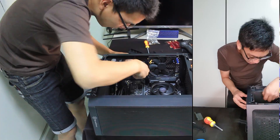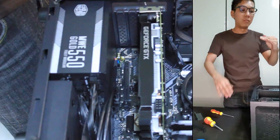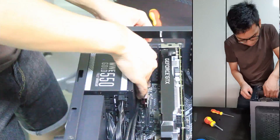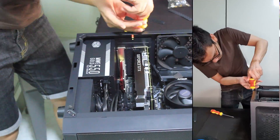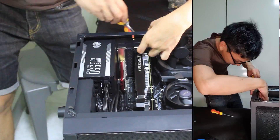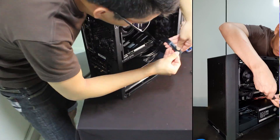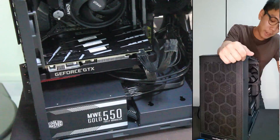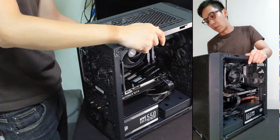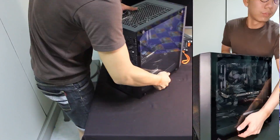After that, remove the front side panels because we are going to be installing the graphics card as shown. Make sure the graphics card latch on the motherboard is down, fit it in firmly and securely, then fit back on the rear panel and screw it in place. The power cables come last, by the way. After everything is firm, connect the power cable to the graphics card — which in this case is a single 8-pin. Now most of it has been completed. Just do a final quick check to make sure everything is good, fit everything back on, and remove the plastic cover on the glass. Then screw back in and everything will be good to go.